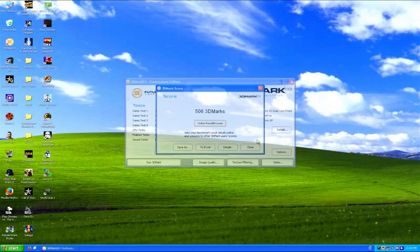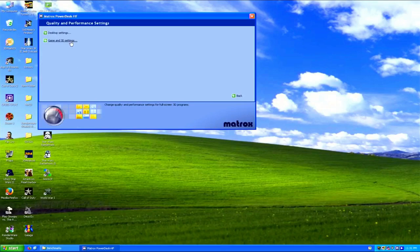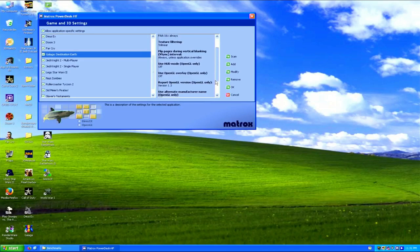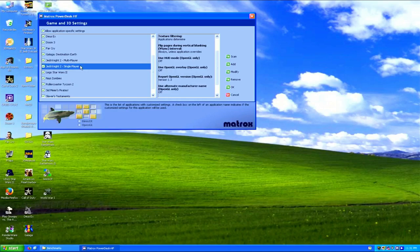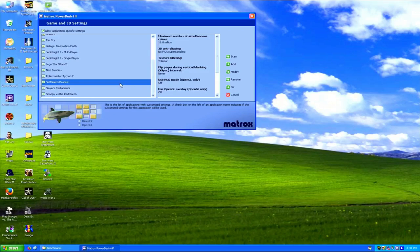Before benchmarking further, it's worth taking a look at some of the driver features. Matrox's driver suite, known as PowerDesk, is quite nice, offering a lot of customizability for monitor setup and application adjustments. I'll have to see about getting analog composite output from the card to test its TV output alongside dual monitors. Looking at the game optimizations, the biggest option is the ability to force 16x fragment anti-aliasing, or even 4x supersampling — really awesome features to clean up the low-resolution images this card will normally produce in gaming. Generally 16x FAA is what we'll be going with, as that strikes a nice balance between performance and image quality. There are also options for reporting OpenGL capabilities differently, probably in relation to the Parhelia architecture's lack of full DX9 or OpenGL 1.4 and up support.